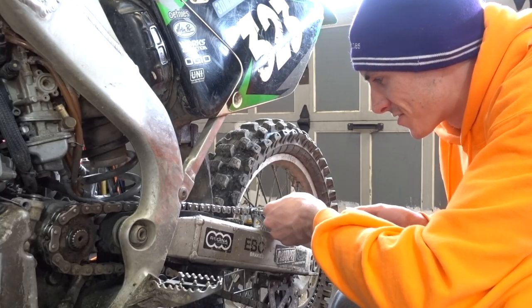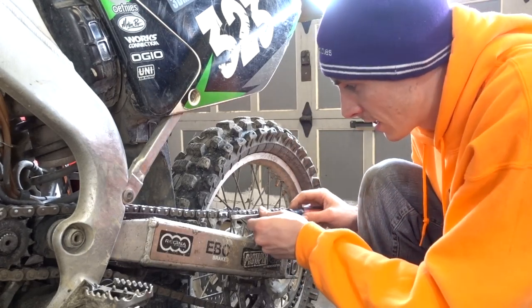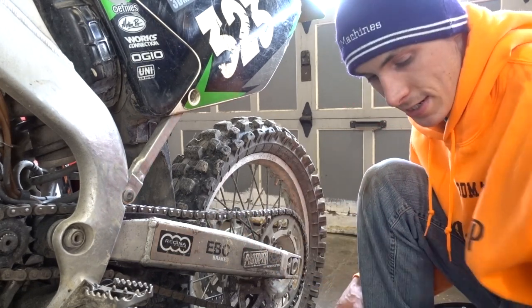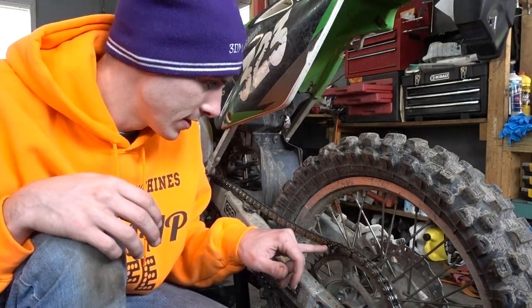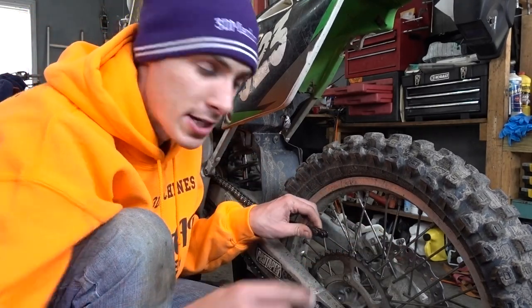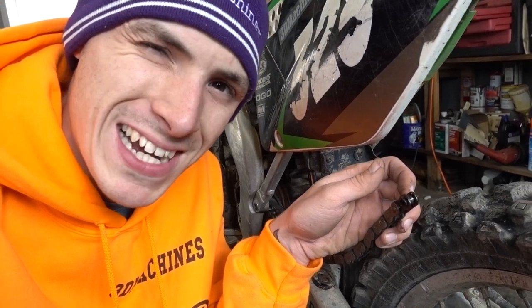This master link is disgusting — that's all kinds of worn. This link is key when it comes to the chain because you can just pop this off. This is on bicycles and a lot of things that have a chain. Just take that clip off, then you have this piece right here, and as you can see it opens right up. Chain splits right in half just like that. Now if you have an O-ring chain like I have, there's an O-ring here and on the other side. Make sure when you put your master link back on that you have both O-rings on both sides.